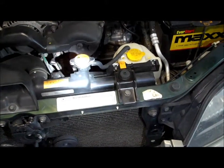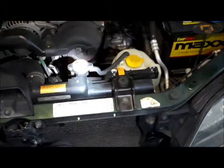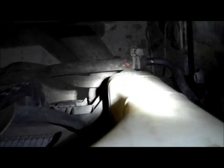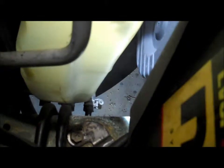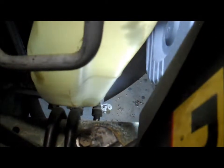I think we'll do a radiator flush in a future episode, as well as how to do your own oil change, but we're sticking to basics today. Let's look at how we're doing with this coolant. Sometimes this is a little bit harder to see than the others — you can see the lines in the container. The top one is full and the bottom one is low, in a cooled condition. Looking over here with the light just right, you can see the fluid is at the low position — not empty, but we need to add some coolant to get it to the top position.